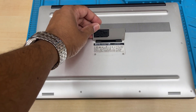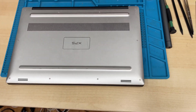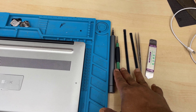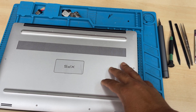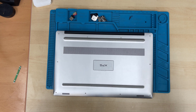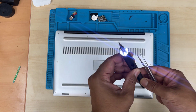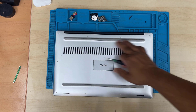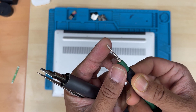If you flip this back over you can see all the details about your machine. I'm doing this video because I found many people that damaged the screws. Make sure if you would like to open up this back cover you use the right tools — if you don't have the right tools you're going to end up cracking the screws and it's pretty difficult to take out broken screws. By the way, this is a T5 screwdriver we're going to use.